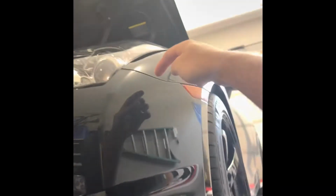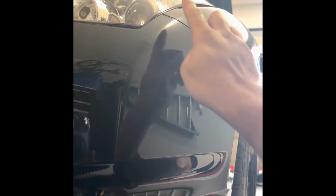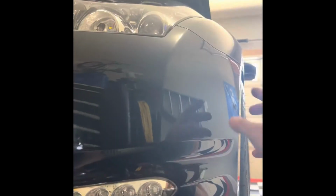You gotta pull it, and there's like these little pins in this area around the headlight that come out. And when you take the fender liner out, you're obviously gonna take the wheel off, but they don't tell you that either, but take the wheel off. Right in this area right here, there's 3 bolts around this side marker. There's one right here, and that one's a little rough to get out. Unplug your side marker light. If you have the fog lights, unplug those too. Then make sure you get these bolts right here in the front, and these little plugs. I think it's this plug, maybe. Anyway, it actually connects this part of the intercooler shroud, whatever it's called, to the bumper right there. So you got to take that off.